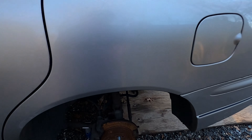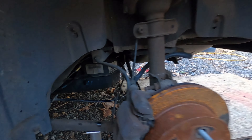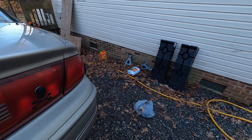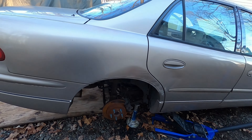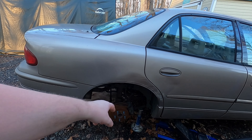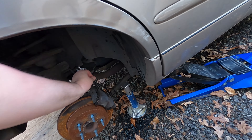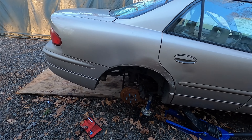We're basically done. What I did off camera: here's the line finished up and zip-tied to the other line just so it doesn't move around. On the other side it's one solid piece all the way over to here and connected to the back of this hose. I bled both sides out — there was a lot of air on this side, didn't get any out of the other side — and now I'm going to put everything back together.